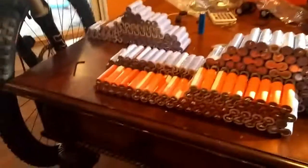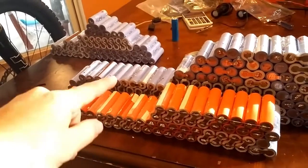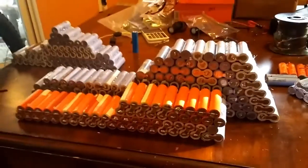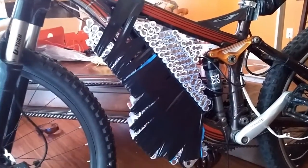So this is how the batteries finally shake out. That's the new top pack, this was the bottom pack — originally 60 cells, now this is the new one and it's 128 cells total, a lot bigger. Now I'm going to put it on the bike. Okay, that's them all mounted — that's the configuration I'm going to go with. Hangs down a little bit low, but that's how you fit 192 batteries on it. Now I'm going to take them apart and solder it up.